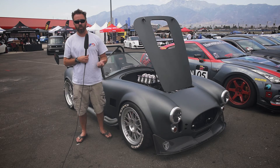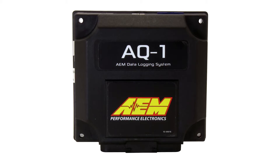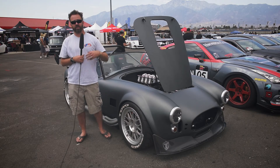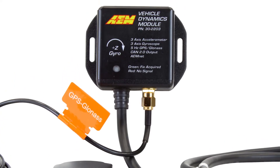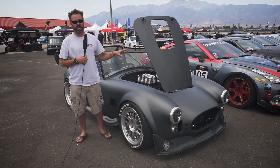We haven't even tied into an AQ1. The AQ1 we use for track mapping, so when we track this car we can get all the accelerometer data. One of the things we might add is the vehicle dynamics module — it's kind of like if you don't need all the features of an AQ1, like having the inputs from additional sensors, we really don't need to use that with having the Infinity.